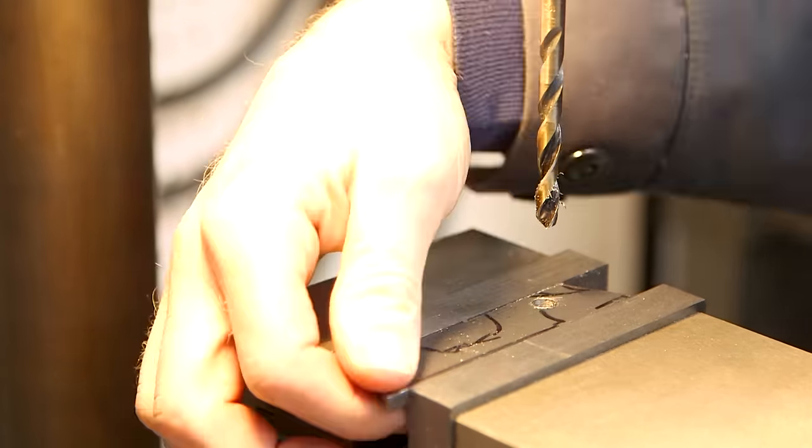That's the mount after welding — I haven't cleaned it up yet, it's still covered in spatter. You can see the discoloration where the heat affected the metal. That braze joint didn't get hot enough to discolor, so it didn't get hot enough to be damaged. The wheel's bolted on with the through axle and the caliper works great. The alignment is spot on — I didn't have any trouble centering the caliper. I'm happy with the way everything looks.